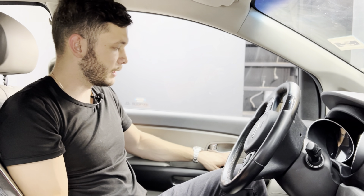Also, as for safety, the automatic unlock function is disabled upon your remote starting your vehicle to prevent vehicle theft. And to activate automatic door lock and unlock, all you have to do is press the lock button on your door, press the brake pedal, hold it, and now press the lock button on your key fob with one small interval, just like that. You're gonna hear either one beep or two beeps. One beep means your function is deactivated, and two beeps, your function is activated. To activate or deactivate, it's pretty much the same procedure.